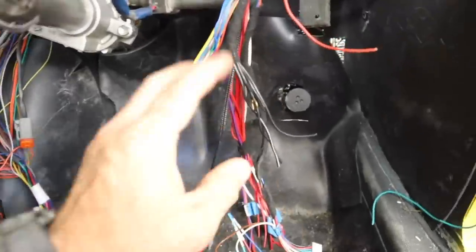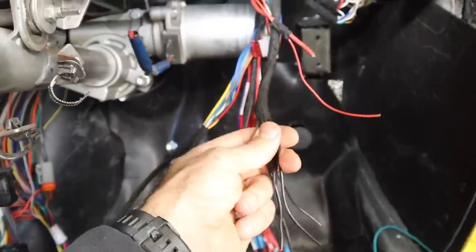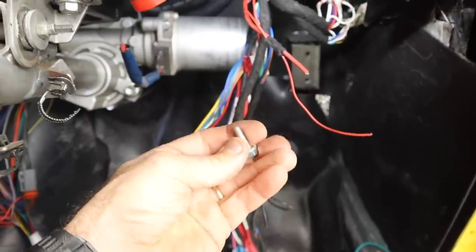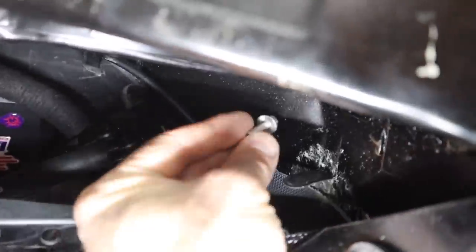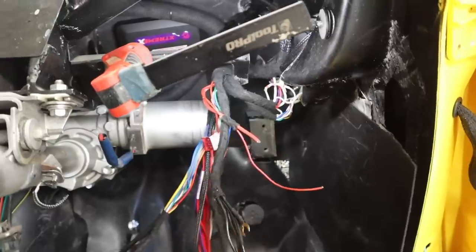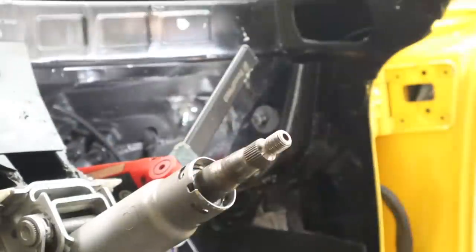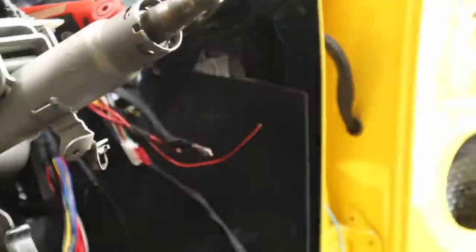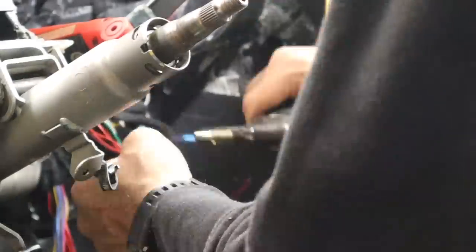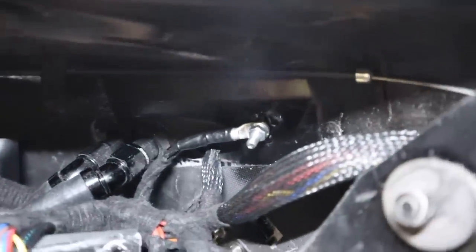All of this mess is organised chaos in theory. All the black wires grouped together are the grounding wires — ground in this car is black. I've got an M6 bolt that I'm going to drill in and weld into the body to make a nice solid ground point. I drill a hole just smaller than the flange head bolt so it sits through nicely, then weld around the edge — a nice easy earth stud. Then I combine the earth wires and bolt them into place.